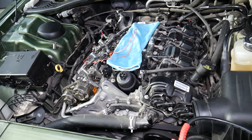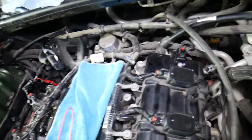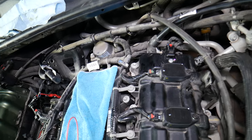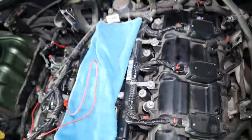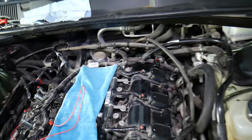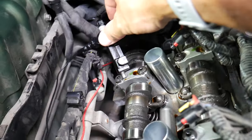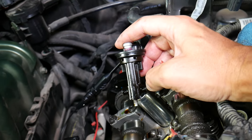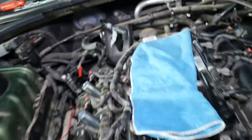Consider this an informative reference, not strictly a how-to video. The four-wire camshaft position sensor is one that actually has two camshaft position sensors integrated into one. That's what we'll be demonstrating — the one with dual variable timing on two camshafts but only one sensor and four wires. Here you can see it taken apart: it has two different components — one known as camshaft sensor two for the intake, and sensor one for the exhaust.